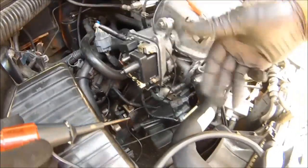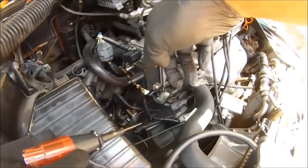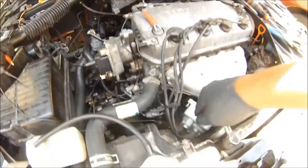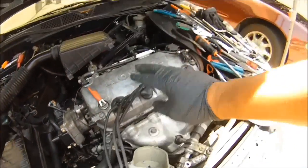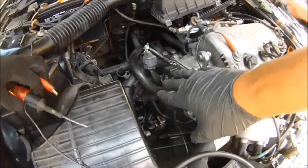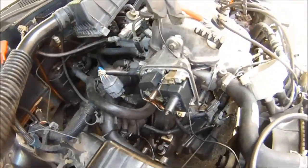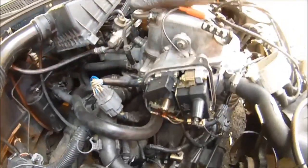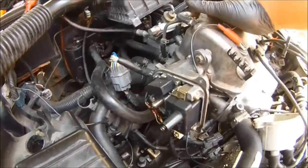There we go — beautiful! Pull it away a little bit further. There we go right there — we've got spark! If this light flickers when you're cranking, that means everything on that side of the igniter is good to go — the igniter and pickup sensors. Put it on the negative and start to crank it. See how it's flickering? That's on the negative side of the primary windings. If it wasn't pulsating, the issue would be on this side, which it was before. Now that we have a new igniter, we have pulsing. The coil is good, the wires and plugs are ruled out, so that just leaves us to the igniter.